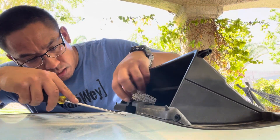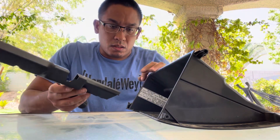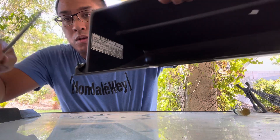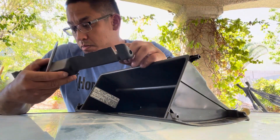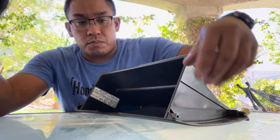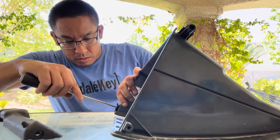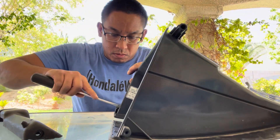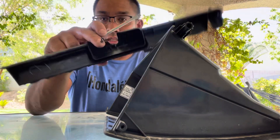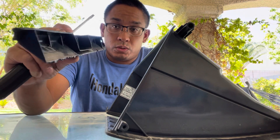What I'm doing is just prying. Like I said, there is a lot of built-up grime on here, and so this is actually glued in there. So we aren't doing this the right way. We've broken a few pieces off from the side — there was a piece broken here. So although it looks to be removable, it's glued on, and you will damage this part if you try to remove it. It's definitely not encouraged to try to pry that off of there.